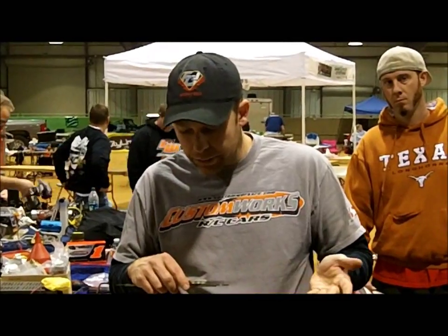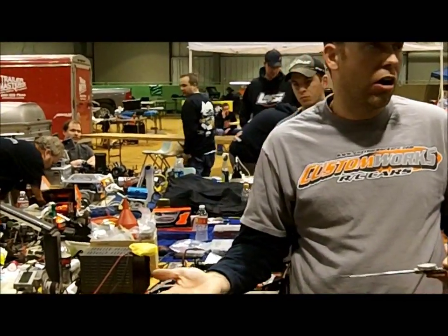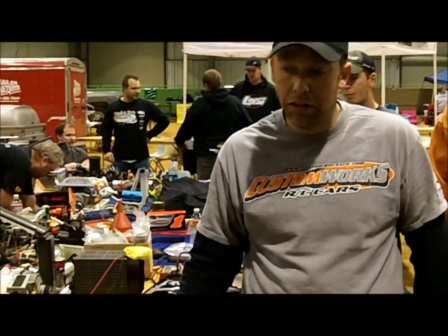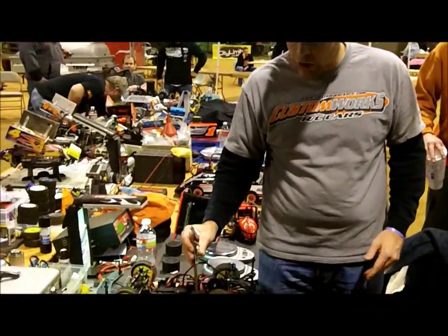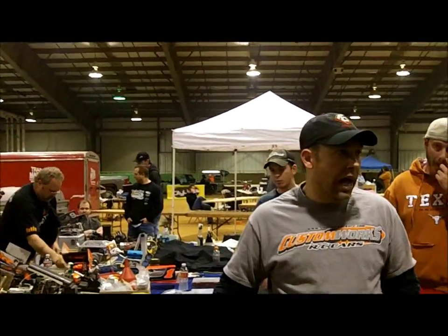So right now this is measuring at that point in the car like 960, so it's really 860 under the car. You really want to know how much clearance it has underneath. But for that sense of vanilla, we'll start with the ride height equal at all four corners. Basically spread it out amongst the chassis.